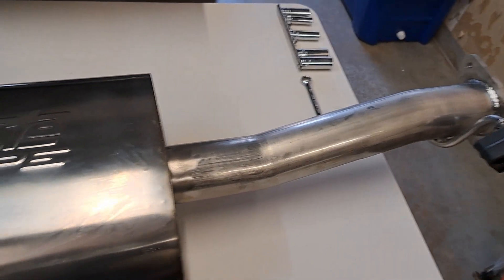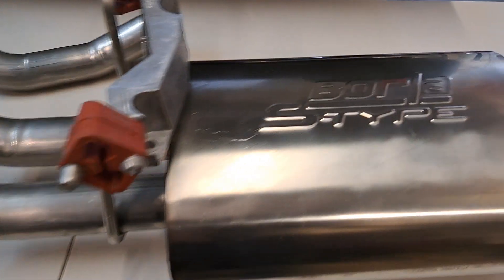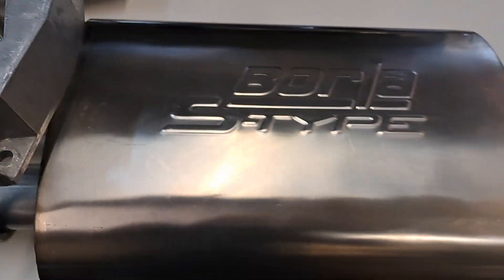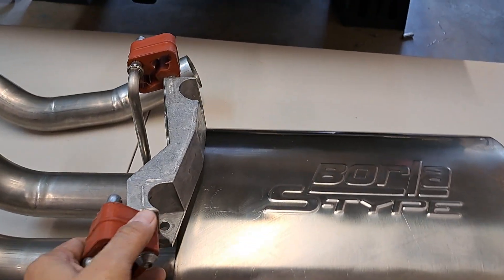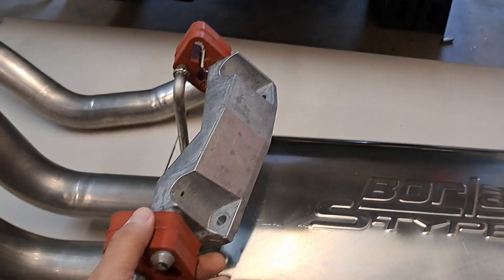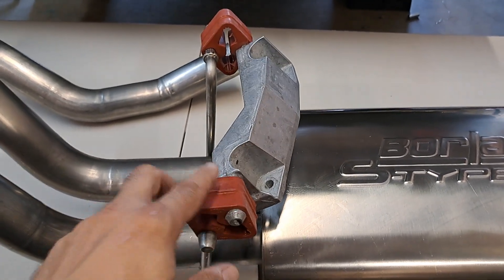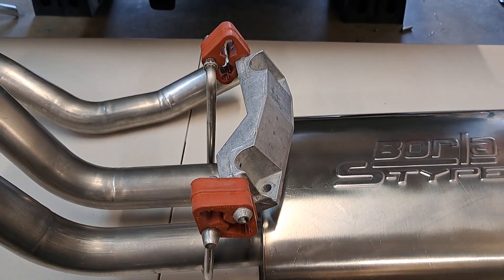The setup itself is a little bit lighter than stock from what I can tell, although I didn't put it on a scale. The other thing I like about this muffler is it is a true flow-through design — no chambers or anything like that in there. I decided to take the mount off as opposed to trying to remove the stock system from the mounts. Those rubber little mount things are a nightmare to get off, and it's so much easier just to take the mount itself off.